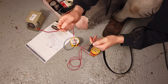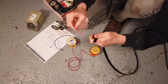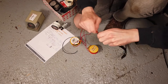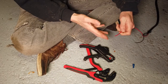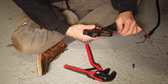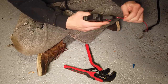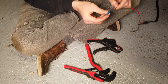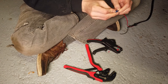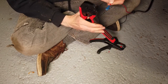I'm going to use the red wire for the temperature sender — red, heat, makes sense — and the black wire for the oil pressure sender, so we'll definitely know which one is which. I'm just putting both wires through the wire wrap now. I've got both wires running through the wire wrap, so I'm going to crimp up the end that connects to the oil temperature sender and then figure out how to route the other one into the engine bay for the oil pressure sender. Just getting the insulation off here. It's a pity I don't have red connectors — colour coordinated — crimp this end up.